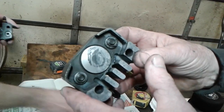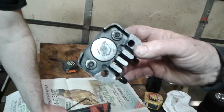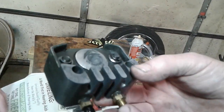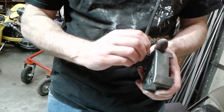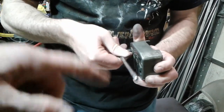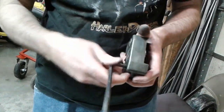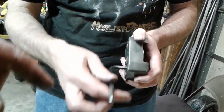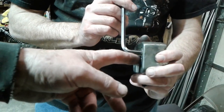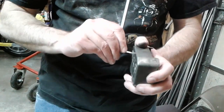So what we want to do here is get this piston out of here. We're going to put air to this fitting and pop this piston out. What he's doing right now is getting this unit ready — he's going to flush these adjusters. When you adjust your brake pads, you use that larger Allen wrench, and he's backing these out and flushing them so when we get ready to put the new pads in, those will already be in position.